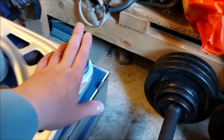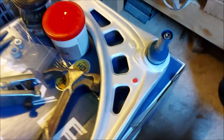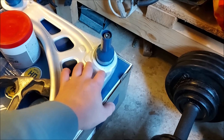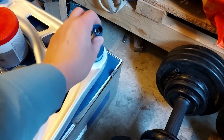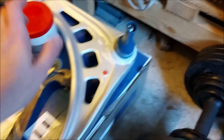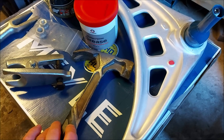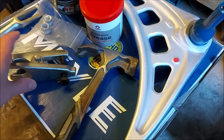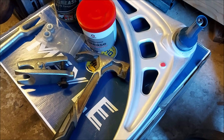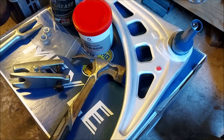You kind of do it in reverse when you refit and fit the new one. It says you might need to get a jack underneath when putting the new one on for the inside ball joint, and you need to grease up the poly bushes on it. Just got to remove the brace underneath the car which is about eight bolts I think, and the cover's already off.